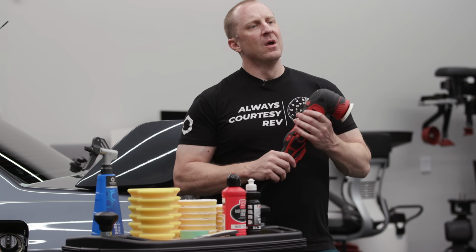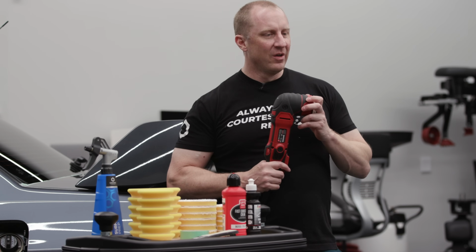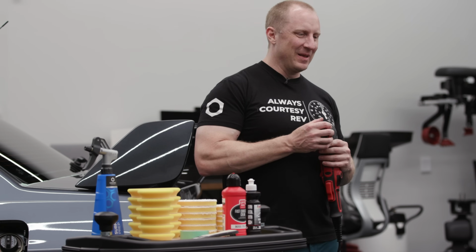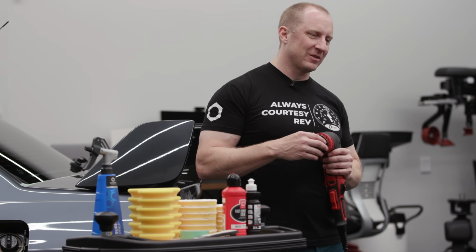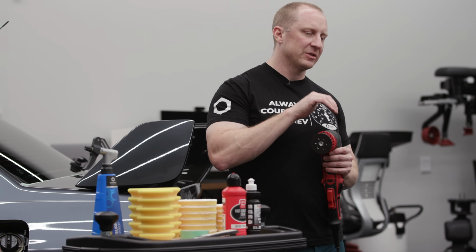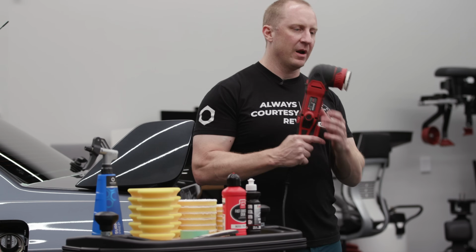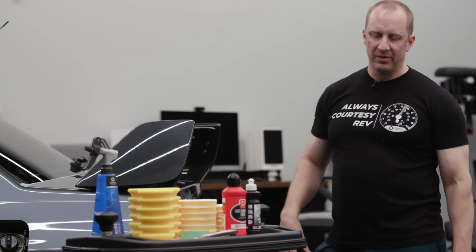I don't recommend you consider the hybrid machines, the PXE80, the new Griot's Boss Hybrid. I just don't like it. It's like you have a machine that's not very good as a 1-inch and it's not very good as a 3-inch, so it's not really good at anything. I want a dedicated machine designed to operate. This is a 13-millimeter orbit, long throw, 3-inch machine, can get a lot of work done, can then hit the areas that you're missing out on that you can't hit with a 5-inch.